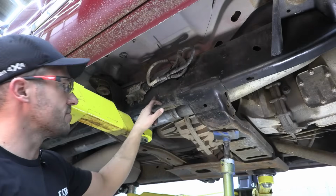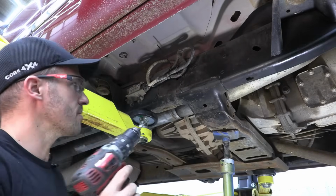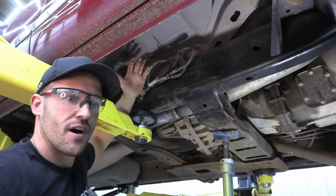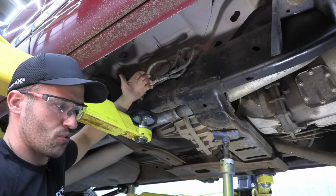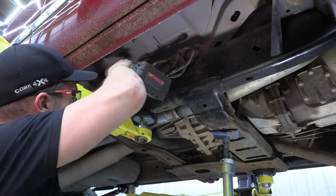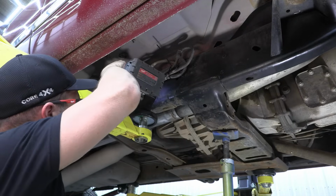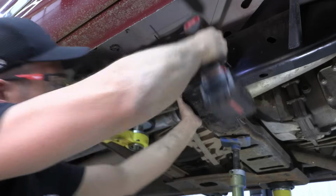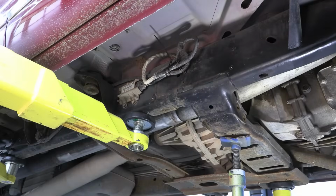All right, so our makeshift punch failed, so I'm just gonna use a little drill bit to kind of get us centered. Ideally, an actual punch would work. Screwdrivers do work, but ours was too small. So we're just going to get a little hole going on center here.